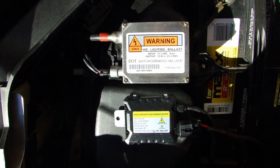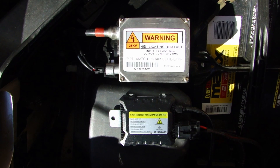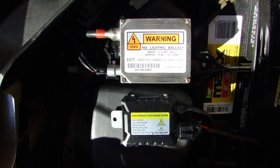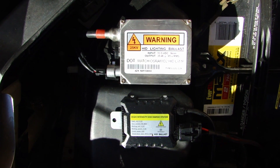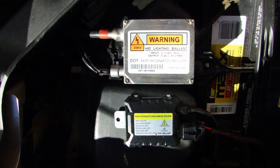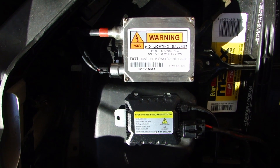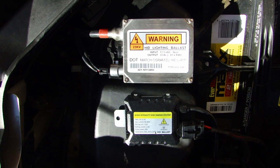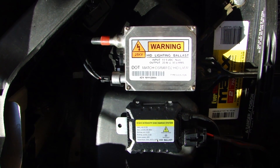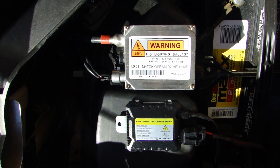What I found out is that this smaller one is actually a DC ballast. When I used the smaller digital ballast, I noticed on my 5000K bulb the light coming out was quite blue, and I was quite surprised because I know the 5000K gives out a very white light. So I did some testing, and that's when I figured out that the digital ballast I have here is actually DC output. I was wondering if it was maybe outputting a lower voltage than recommended, but actually the voltage output was correct — it's just that it was DC voltage, whereas on the bigger older style ballast, it was truly AC voltage coming out.